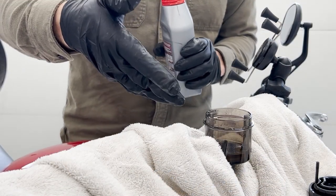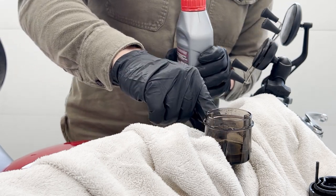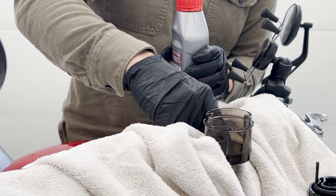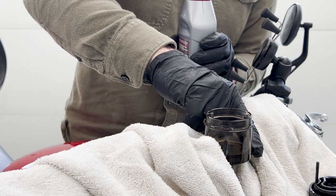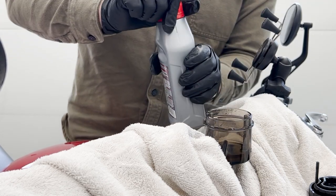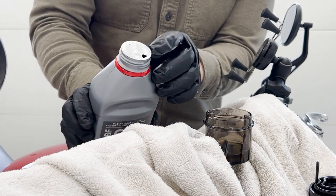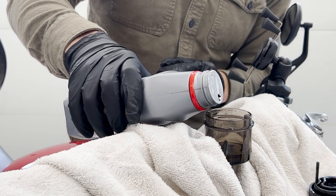So now we've drained it pretty low — not all the way to the bottom. We don't want to bring air into the system, so I've stopped probably five or six millimeters from the bottom of the reservoir. On the Speed Twin, it draws from the very bottom of the reservoir. Some bikes actually draw from the side of the reservoir, so be careful — if you're bleeding the brakes on a bike like that, you don't want to get anywhere near that opening. One tip: rather than taking all of the foil at the top off the brake fluid bottle, just open it up a little bit and put a small hole at the top to let air back in — it makes pouring the fluid much easier.